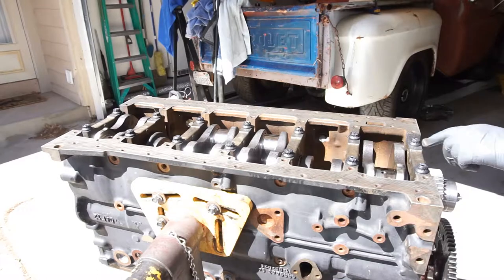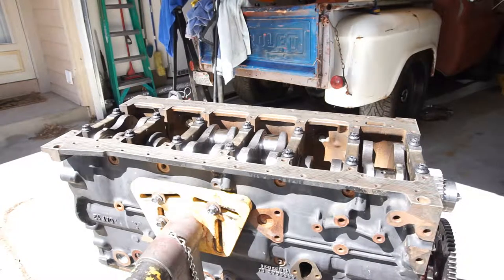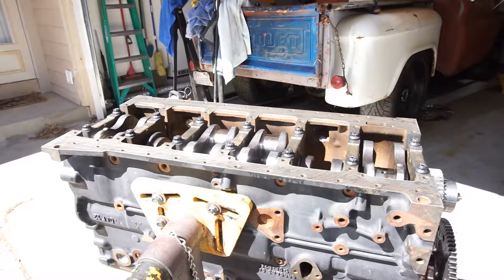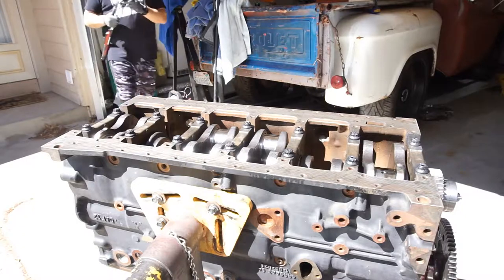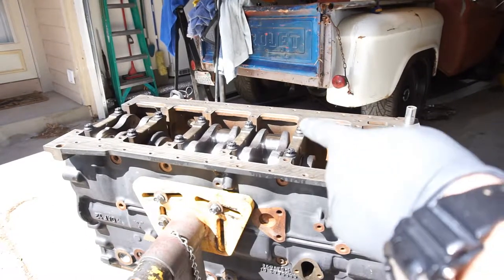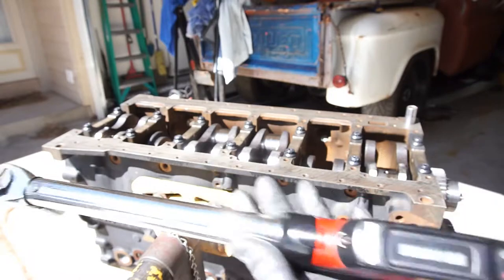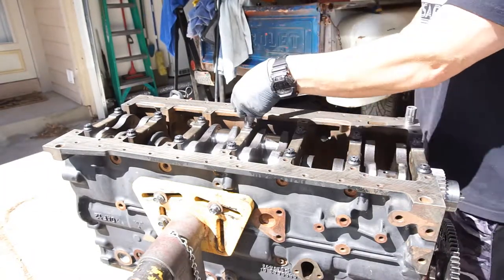Okay, well, I'll go ahead and torque all these down in equal increments, I guess. That's what it says. Alright, I'm going to torque them down. I'm going to start from the middle, do those two. I'm going to torque them down first with 45 foot-pounds. I don't know if you can see it. If not, oh well, trust me. It's a 16 millimeter, 12 point.